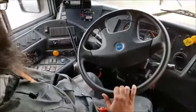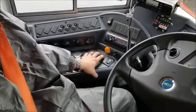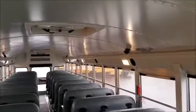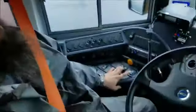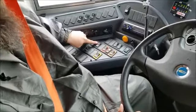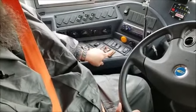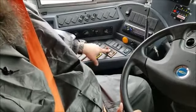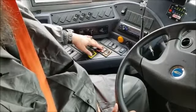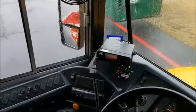First I'm going to begin with all of my driver switches. I've got the driver and passenger dome lights — they're all working properly, securely mounted to the bus, and all proper color. Next I've got my master flasher row. I'm going to turn the master flasher switch on and turn on my amber warning lights. I can see the indicator is working. Next I'm going to use my red override switch to operate my red loading lights, and my stop signs have come out — they're working properly.